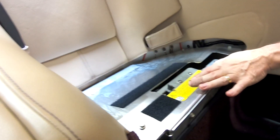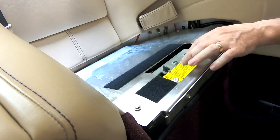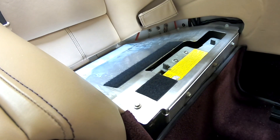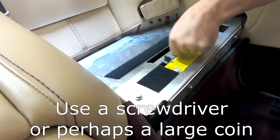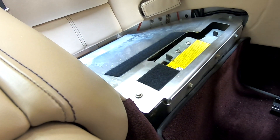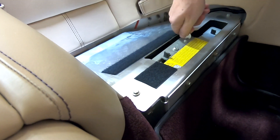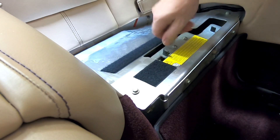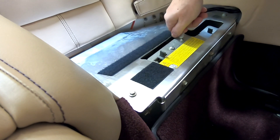Underneath here is the emergency park override lever. The owner's manual says there should be some knurled thumb screws that you can undo. Instead, there are two slot head screws we need to undo — they've got a big slot in them. You can use a quarter or a pound coin to get these loosened up, because remember, you're supposedly doing this stuck at the roadside or in a parking garage. You can always use an actual screwdriver. Maybe later models have a thumb screw — if yours does, please feel free to comment below.